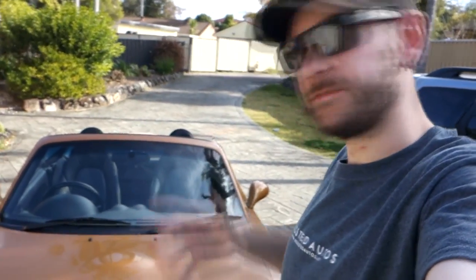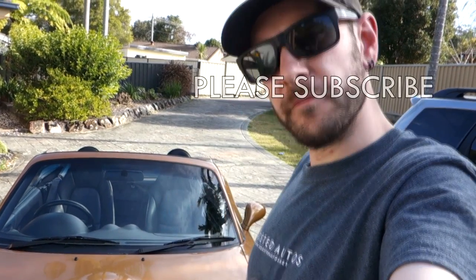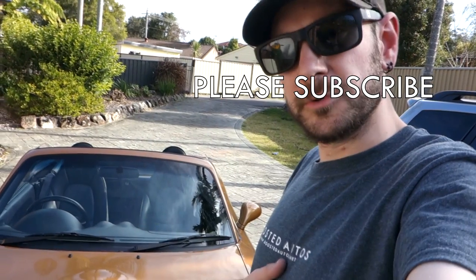It looks pretty horrible but the surfaces are now completely smooth to touch, which is exactly what we were trying to achieve - and that will be perfectly fine for wrapping. That is beautiful and smooth now as well; there's no bump where the dent was. We can also just give it a light buff to get rid of any overspray - I was a little bit lazy and didn't mask around it like I probably should have, but we'll polish all that off. That is how I've prepped this section of the car for wrapping. Let me know in the comments below if you do it differently - obviously I'm not a professional, this is completely just me figuring stuff out as I go. Thank you very much for watching, like the video, subscribe to the channel if you haven't already, don't forget our giveaway, and I'll see you next time. Bye.